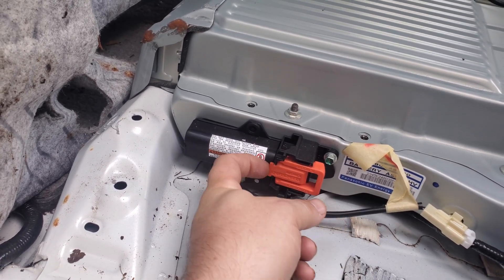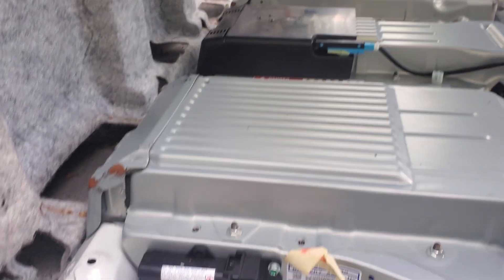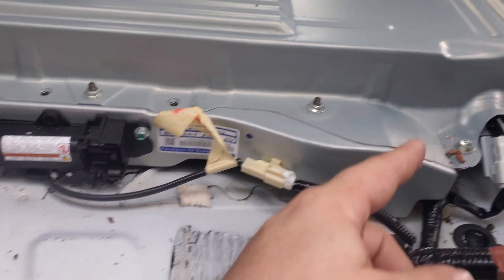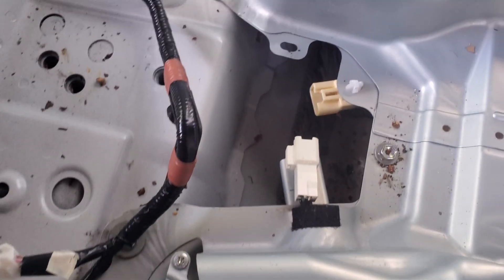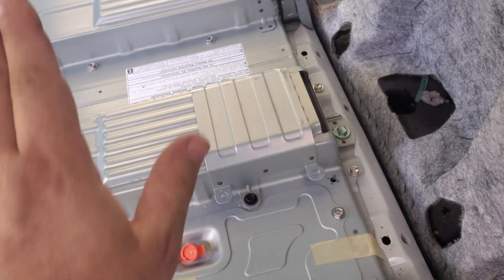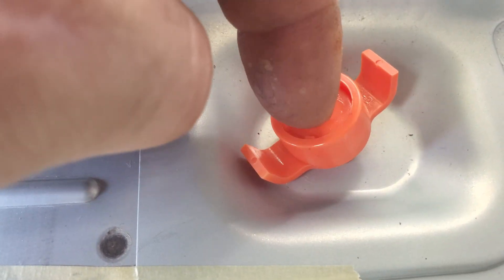From what I can find, you're going to unhook this service plug here, then wait at least five minutes before working on it. While waiting, go ahead and unhook the surrounding connectors. Pull the vent plug — make sure when you put it back it goes in the same hole. Disconnect all the little connectors here. There's a little cover that pops off, then an anti-tamper piece — put your needle nose pliers in there, spread them on both sides of the tooth, push down and turn, and it'll pop up. Once it pops up, stop turning.